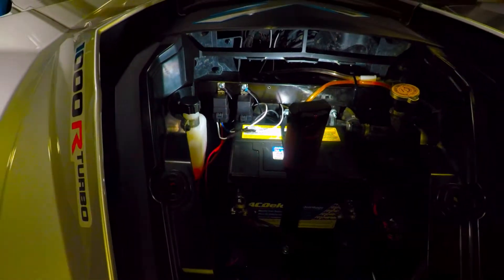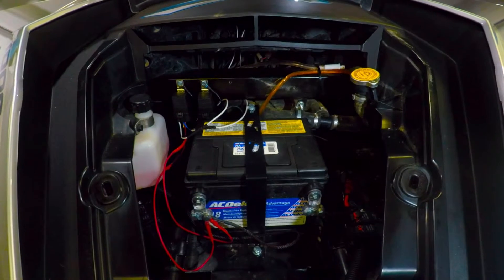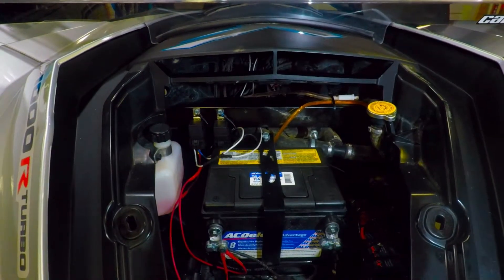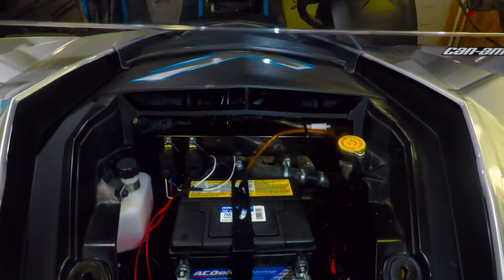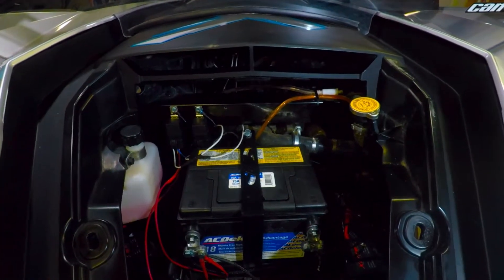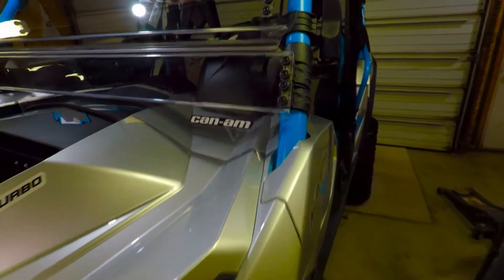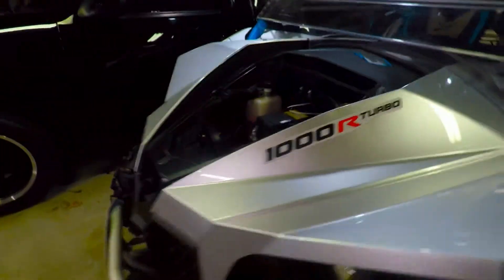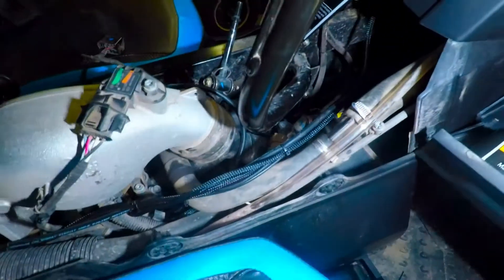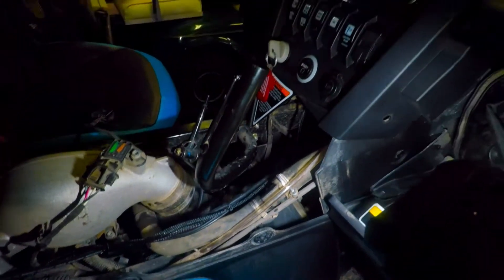That's really all there is to it. By having everything wired like that, if something shorts out or breaks, it's just going to be that particular accessory not working — it's not going to leave me stranded on a trail, short out and damage my motor or charging system, or cause a fire. So it's a really good idea to use relays. Now let's look inside at the motor — you can see I went with the loom, everything wired is encapsulated.